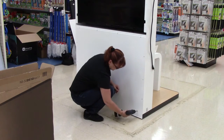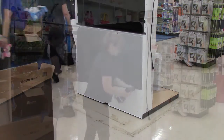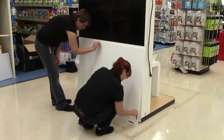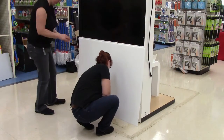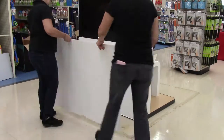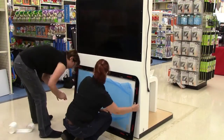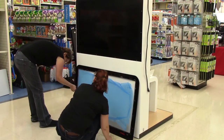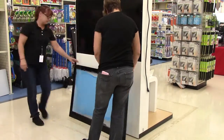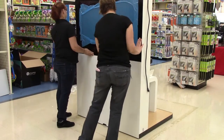Replace the lower rear metal panel that you removed previously to access the interior of the display, ensuring that the lip at the bottom is facing outward. Reinstall the rear upper metal panel using steps similar to the replacement of the front upper metal panel. Then install the rear bottom white acrylic, following similar steps as the installation of the front lower white acrylic. Ensure that the groove at the bottom of this panel lines up with the notch at the bottom of the lower rear metal panel. Then install the upper clear acrylic TV cover using the same double-sided tape and ensuring that you've cleaned not only the TV but the rear-facing portion of the acrylic cover.